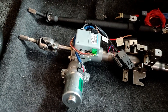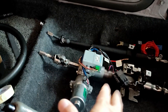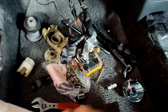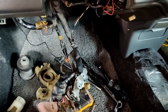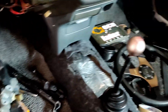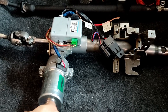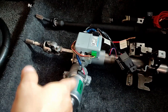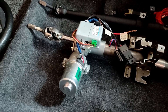I think they are the same length and size, but I'm going to install this first and then do a test while the car is moving at around 80 to 120 kph, or maybe while the car is idling at standstill, to see if the steering is smooth left to right. I didn't bother filming all the removal process — I made separate videos since it would take too long. This is only a conversion; I think the motor is from Suzuki, Mazda, Hyundai, or Nissan — definitely not made for Honda. My friend has already installed more than 100 units of this EPS to Civics, sedans, ESIs, and even Mini Coopers.